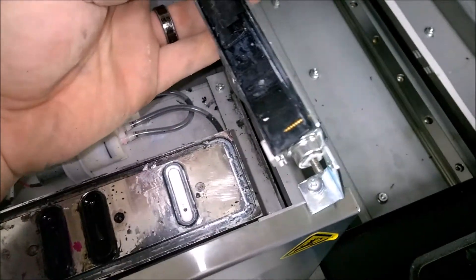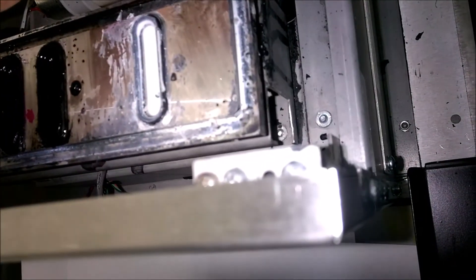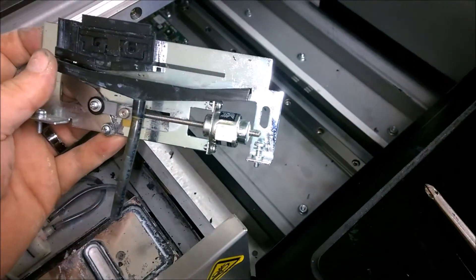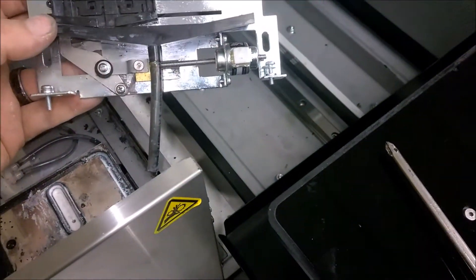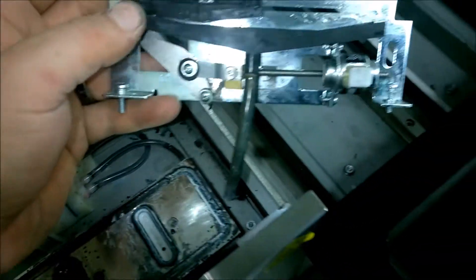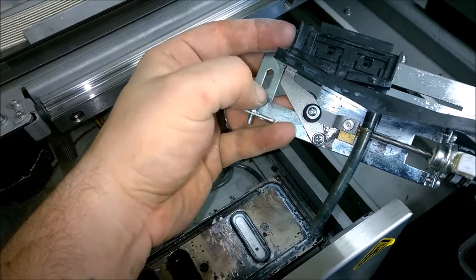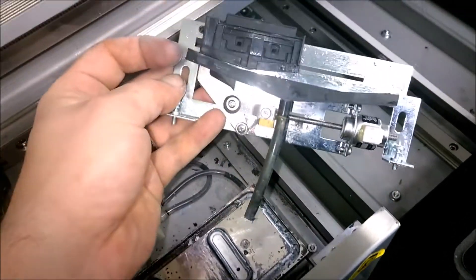So as I was saying when taking it out, the stepper motor does need to fit in that little groove. I'll put the camera down when I try and fit everything in. Then you're just going to put the two screws back in that you took out originally — one goes on this side, the other one goes on this side. The screws on the bottom don't screw into anything — it's mostly just for level. So for some reason this one's pushed all the way in. We're going to put it back in and then we're going to test it.